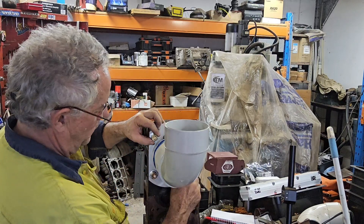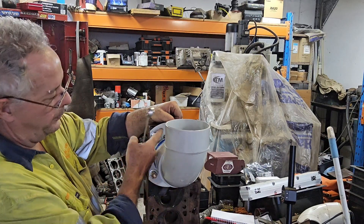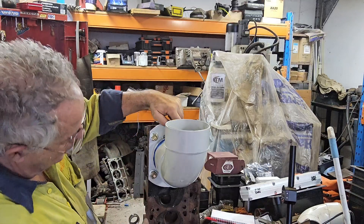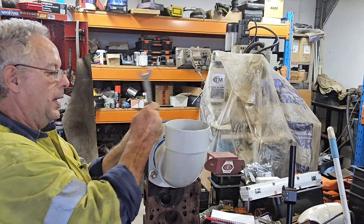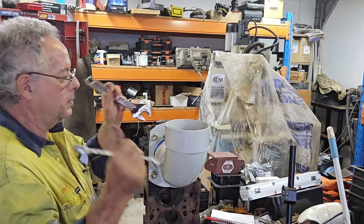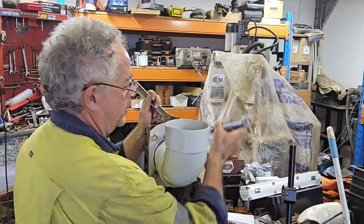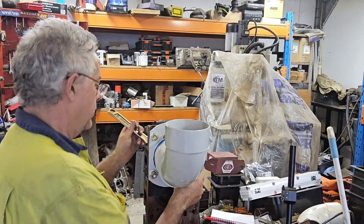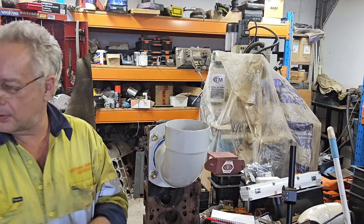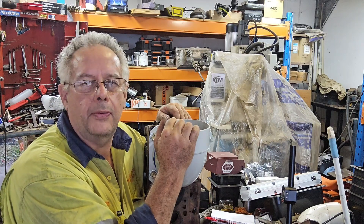Because this is glued together I can't see where I am now, but when I first fitted it up, what I did was I actually marked it — intake valve here, push that way — and what that does is that gives me my bore location, my centralised bore location. 100mm PVC pipe actually measures out at 103.3 millimetres, which is 4.07-something — nearly 80 thou over — but it doesn't matter, it's adequately close for what we are trying to do.